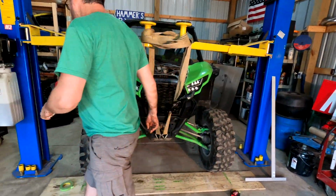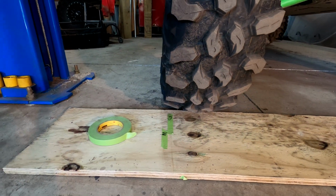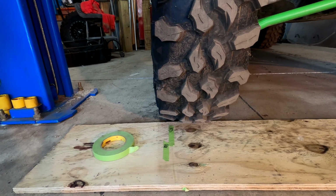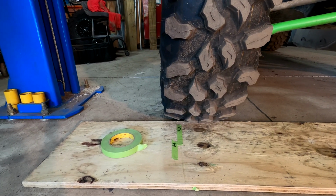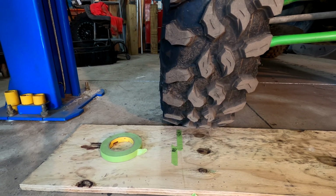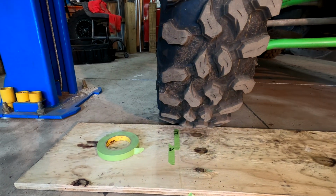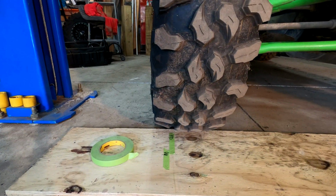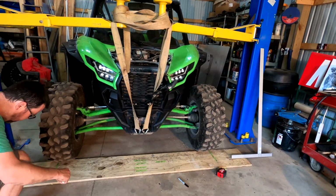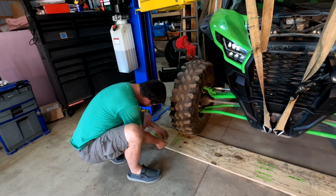Let's go down. Let me know when we hit the A-arms completely flat. I'll go with the lowers because that's usually what you go off with. Keep going, right about there. The lower arms are about level. We'll call this 2/3. This is where we're getting into what our real usable travel is when you're going through whoops and such. Realistic travel, we'll call it.